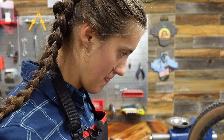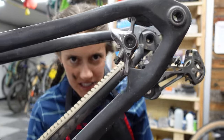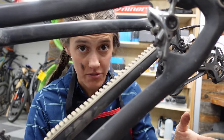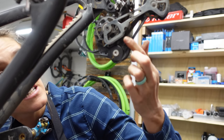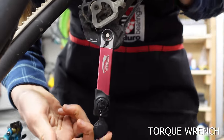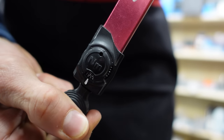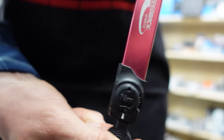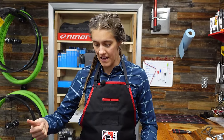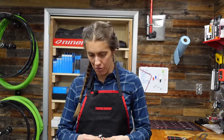This will actually be easier if we pull the rear wheel — so let's pull the rear wheel. Shall we adjust this derailleur? Just a quick reiteration on what we talked about: how do you know if you need to adjust it? Basically if you're getting a lot of chain slap, or if you've had your bike or put a new derailleur on about a month ago. Do you see this T25 bolt? So you'll need a torque wrench with a T25. I'm pulling here until it breaks free — it's pretty tight, breaking free at about 5 Nm, which is on the upper range of what the setting should be.